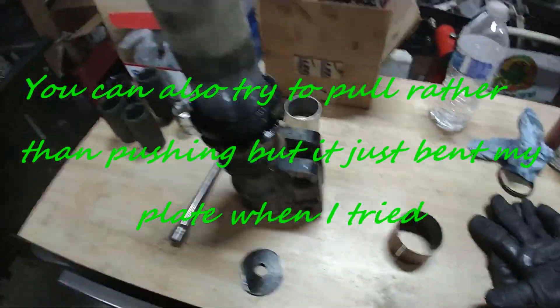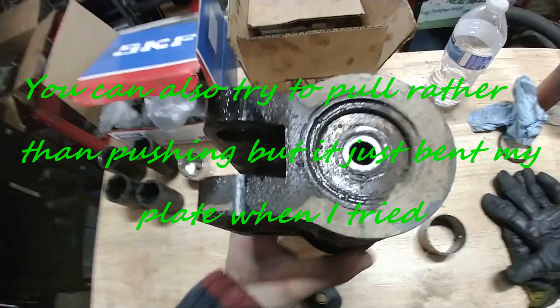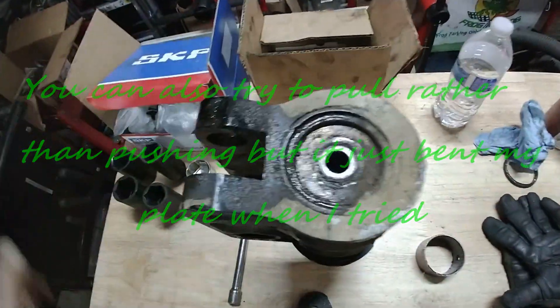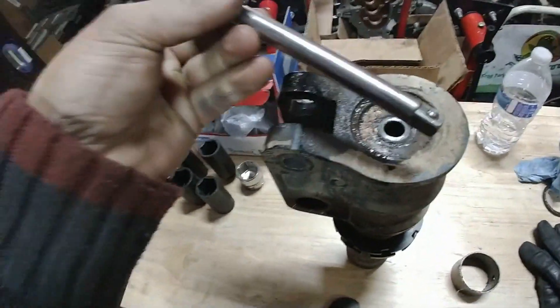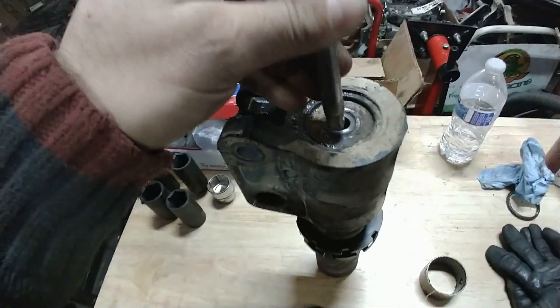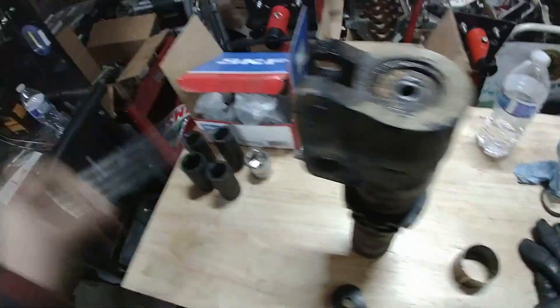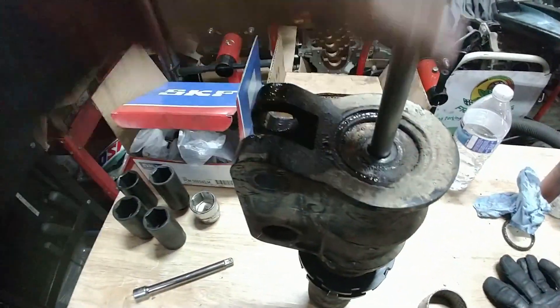The technique to push from the back of the strut - there's not much of an opening there, that's just where the shaft of the strut comes. But through there you can fit a 3/8 extension. I have one that fits - yes, this one. So here you can fit the 3/8 extension.